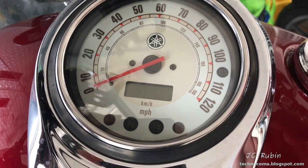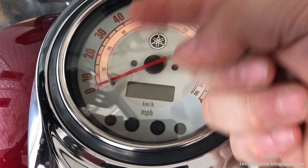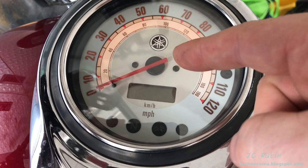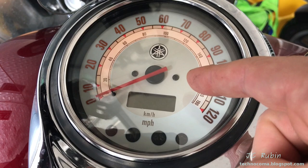We test out the bikes by going to the coast, and one of the problems I started to notice on my speedometer — this whole console — was that the speedometer was dying, as well as the liquid crystal display. The needle would drop down to zero; you can see it's on and there's no display. This is a sign of a charging system not working correctly or a bad connection.